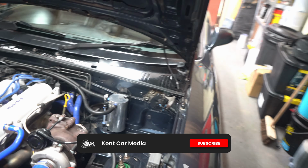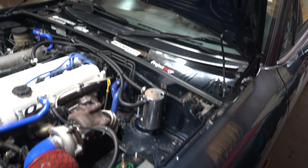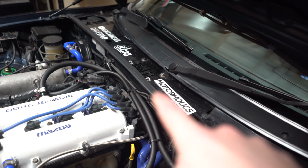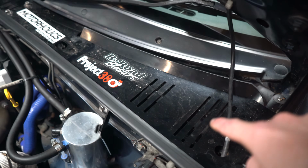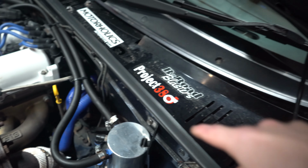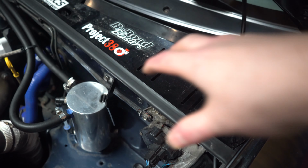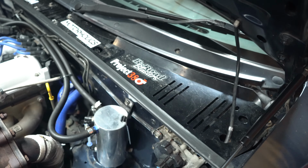Now, you can get some water coming supposedly from the front of the car, and what you're going to want to do is check the front scuttle panel. Most MX5s don't have this whole nice metal piece. It's all open, and then you'll have your little plastic square here. Underneath that, if big leaves build up, the drain supposedly doesn't work down into the front arch. So it's worth checking that.